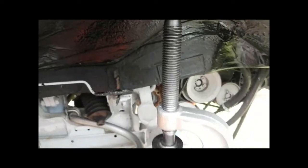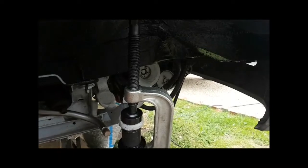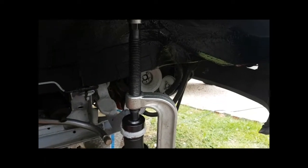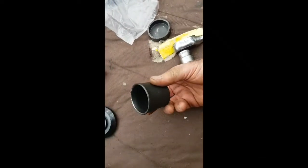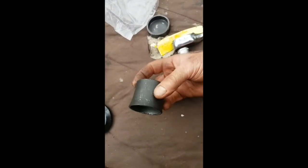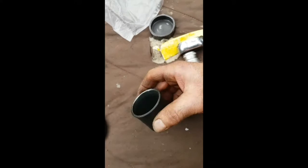Try to get it as straight as you can so it goes in evenly. You want the big extension bar on that, and then clockwise, just keep going down with it. I've got it part of the way in - just to show you the amount of pressure: this is meant to be a perfect cylinder, but with the pressure I've been putting on it, it's ovalled out. I know it's not the best quality, and that's started to bend as well.